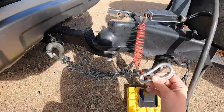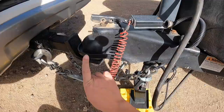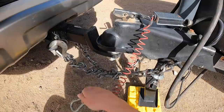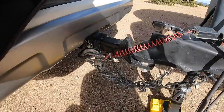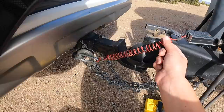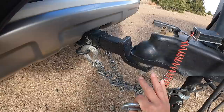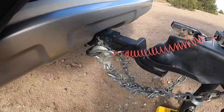The next item is the emergency brake. I actually traveled for about 6 months never hooking this up because I did not know what it was. It's a brake that, again, if the trailer ever becomes disconnected, will put brakes on the trailer so that it stops. Make sure that is connected over to your hitch as well. There are stories where the actual whole hitch does come off from the truck. So if you did have a place to put an eye bolt in your bumper that you could actually attach this to, that would guarantee if anything ever happens, your brake would go off.